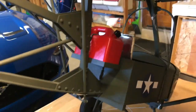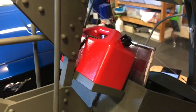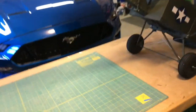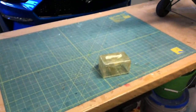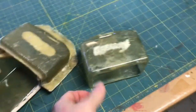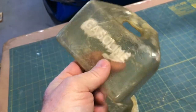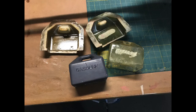The required five-gallon gas tank, which all these ultralights have, is fiberglass — it's hollow. Made up a mold. Used one layer of three-ounce cloth, but it just wasn't quite thick enough — a little too flimsy. The new one is two layers and weighs a little less than two ounces.